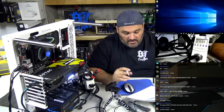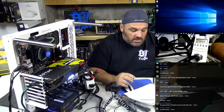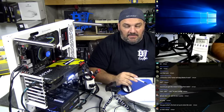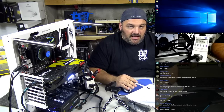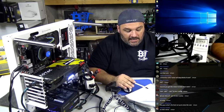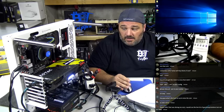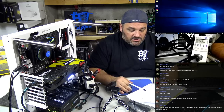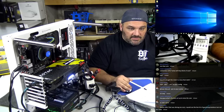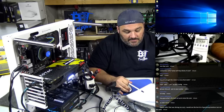And then we obviously at the end here, we did a full out run on it, which was giving it 110 on the power limit and 275 on the core clock and 1,000 on the memory, resulting in 198 watts on the card. The full system was about 250, or close to it. So that's more than TDP. I thought TDP was like 175 on this card, but Zotac may have upped it.